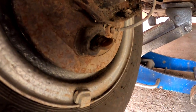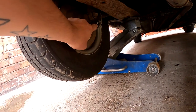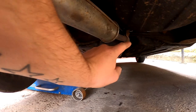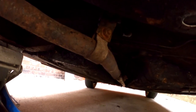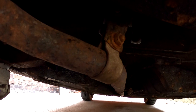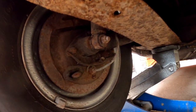So the clevis pin goes onto that — it runs through there and connects onto the back of the drum, then runs through and comes around the subframe through the hole in the subframe, then there's a coupling on the subframe. It runs and runs down the car. Being an earlier car, it has two cables. Let's get the new one routed up and I'll bring you to the front of the car.